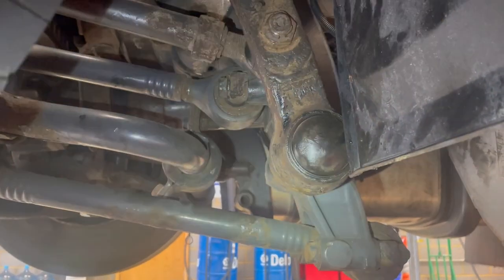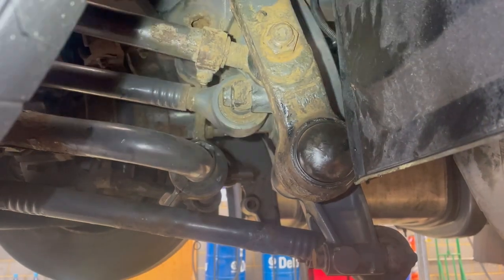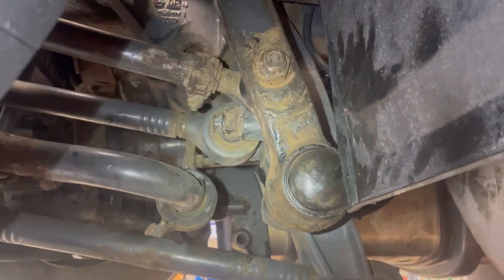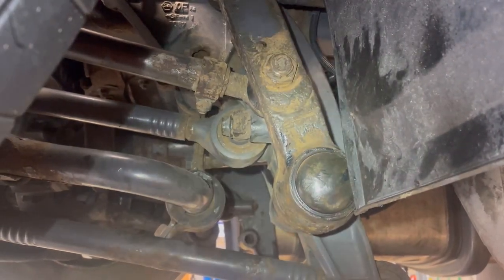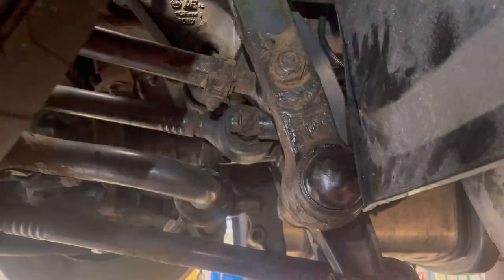So that is it on, cap back on, the two steering draglets, I'm gonna call them, are all bolted back on and secured, and that is it done. No play in it. Two new bearings, new racers, new seal, new nuts, new washers and everything, so that's all secure. So I'm gonna end this video here, and yeah, it's another job done.